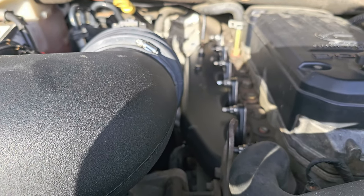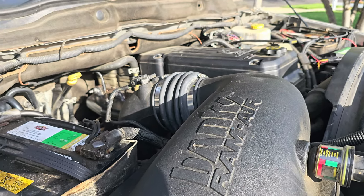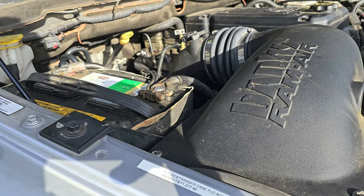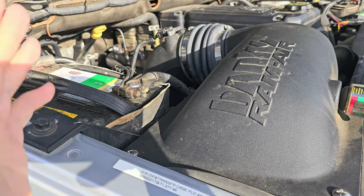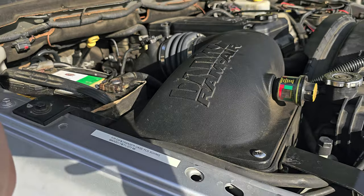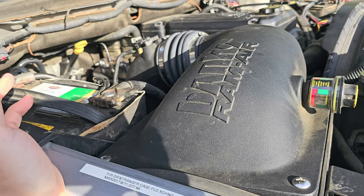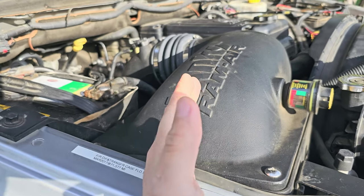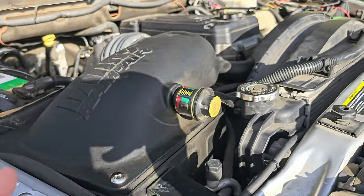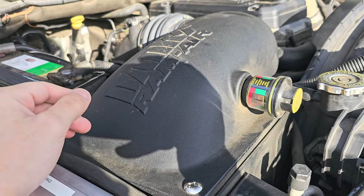Response, of course — going from what I think is like a 58 or 60mm compressor and 58mm turbine up to a 66mm — the response is not going to hit with as much torque. That's guaranteed. But even driving unloaded with no trailer, we're getting into full boost with no surge at like 1700 RPM. And where the stock charger would fall down right at 2100-2200 and just start pumping more heat into the system, this thing really catches legs over 2200, and from there to redline and beyond is wicked up.